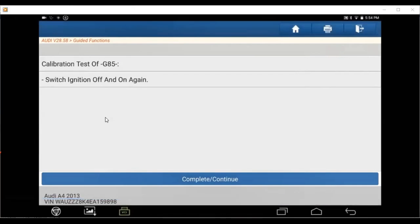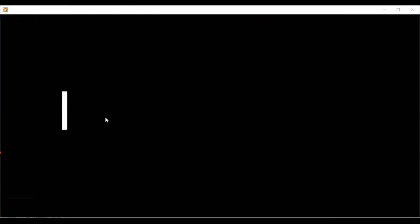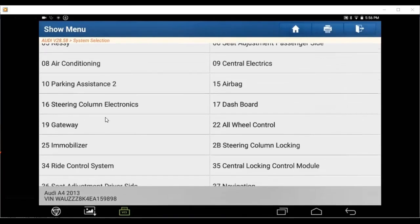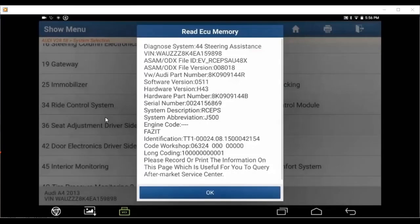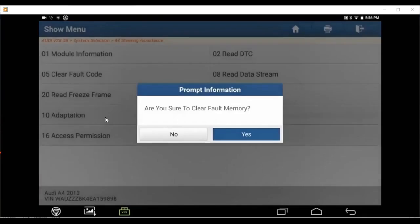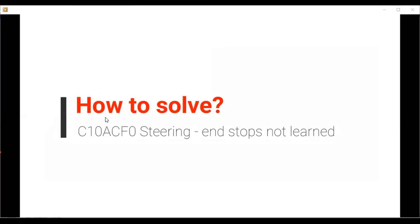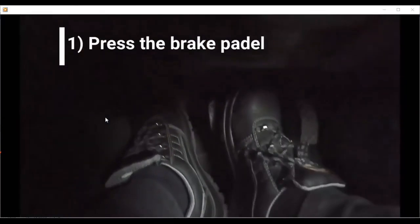It will also guide you — you need to restart, turn off the engine, and restart the control module. Once it's done, you can check again with the trouble code to make sure there are no more trouble codes. If a trouble code comes out again, try to clear it. Some steering angle sensors at the last step still need to do this step.